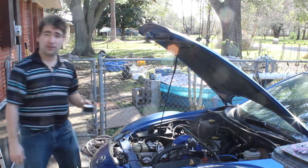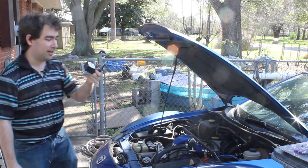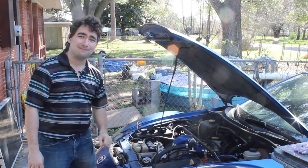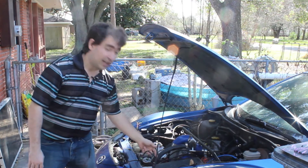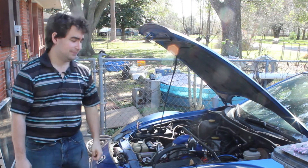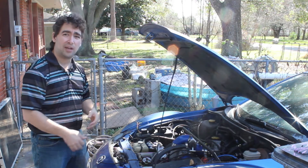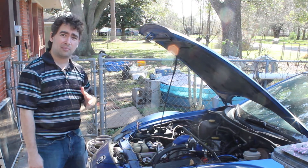What could it be? At first I thought it had to be the coil driver — it has continuity where it shouldn't have continuity, something's wrong. But replacing it didn't solve the problem and led to it blowing ignition fuses. So then I started checking the coils, and out of the four coils I have, three were bad. I've been driving with these new ignition coils for under 3,000 miles — probably under 1,000 miles. And yeah, they failed. Three of them all at once.